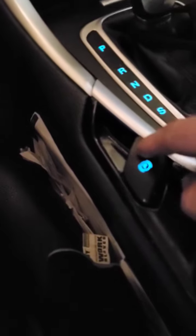So what we're going to do is start with the key off. We're going to turn the key to the on position, not start it. I'm going to put my foot on the accelerator and hold the accelerator all the way down. Then I'm going to take the parking brake and put it into disengage.